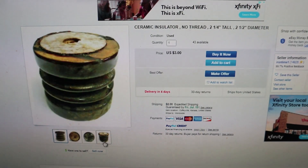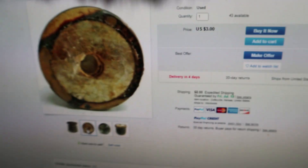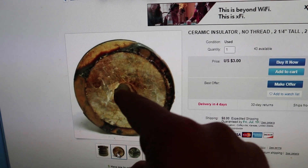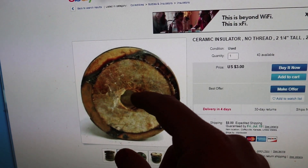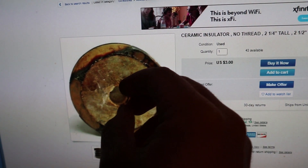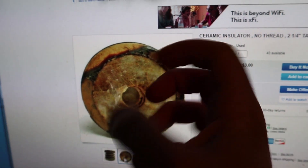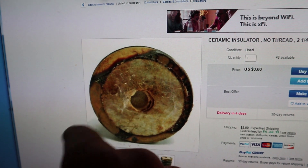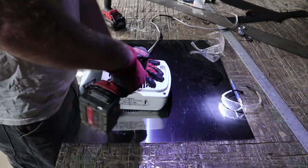The wire is not as flexible as some others, so bigger diameter can help reduce problems. The insulator doesn't have a hole entirely through it, so if you don't have a diamond hole saw of the same diameter, you might be able to get a regular ceramic drill bit and drill a hole for a bolt. On the open end, get some small bearings and put a bearing in there with some washers on the bottom so it slides around. You'll have a pivot point on top and bottom with tight enough tolerances — I consider what I made to be quite adequate. That's an option for about $16.